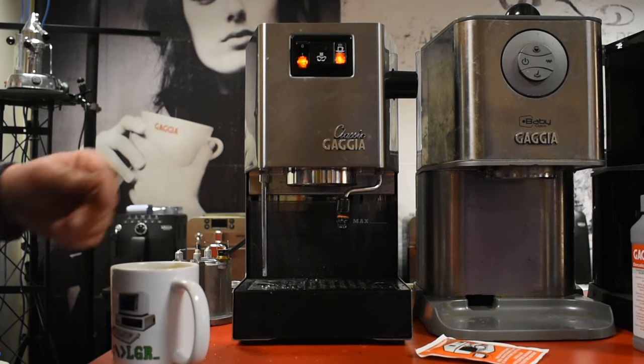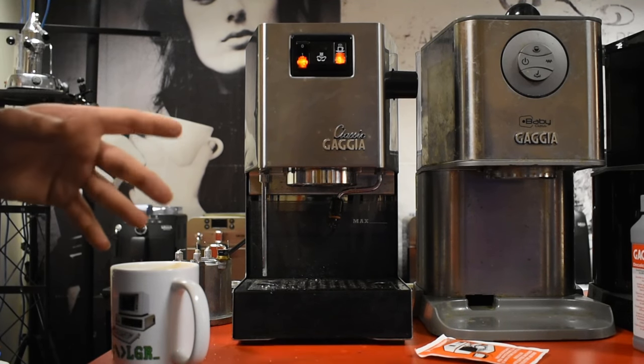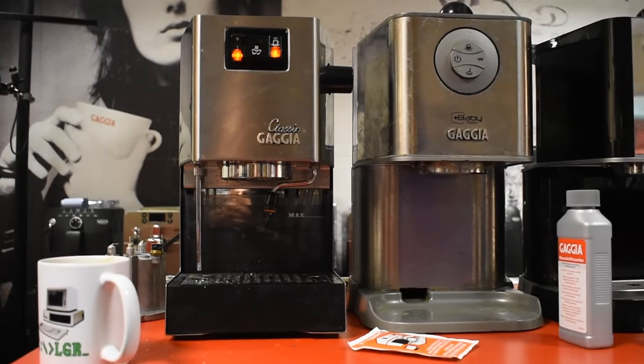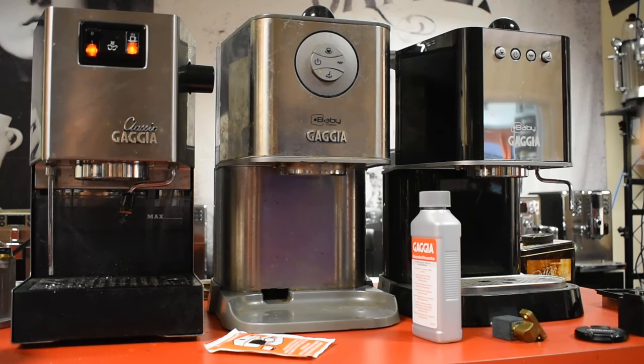Do keep going, because you are unblocking that solenoid valve and breaking up those tiny pieces of scale. It's not a binary thing — it's not like when you fix it, it'll all come out in a rush. You need to keep going. You'll have to use the coffee button and the steam button on these machines. If you've got any questions, do give us a ring — the number to call if you're in the United Kingdom is just down there in the description. There are other tutorials on our website. If this doesn't fix it, it could be something else. Other than that, enjoy your coffee.